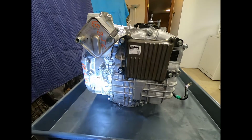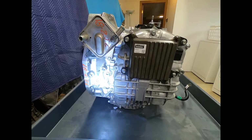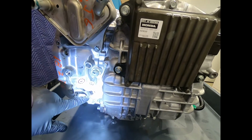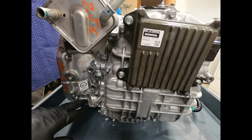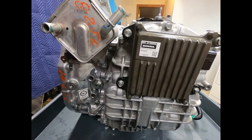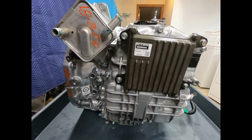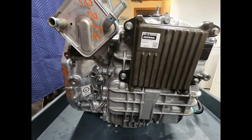With the Honda 10-speed automatic transmission, we do not have a dipstick. Instead, you'll notice that I have a fill plug and then a level test. So obviously I would simply fill the transmission until the transmission fluid level is at this point. And obviously Honda has a routine for doing this: engine at normal operating temperature, engine running, etc. Note the decal specifying the Honda transmission fluid desired in this unit.